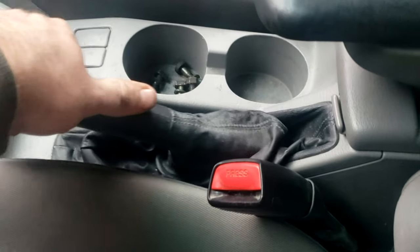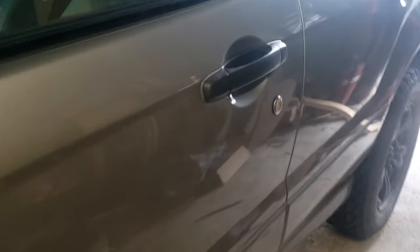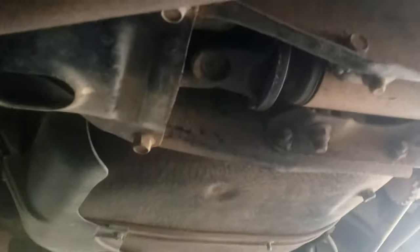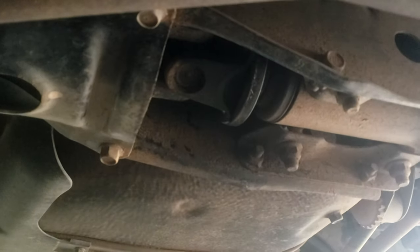We will need to get under the car, so the first thing to do is simply set the parking brake. From there we need to access the front of the rear differential or the rear of the driveshaft — I'm showing how to get to it here. On some vehicles you may need a ramp to access this. I did not need a ramp for this vehicle but I did for the Legacy GT shown in the opening clip.